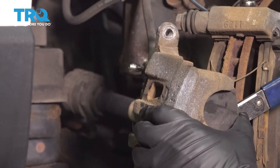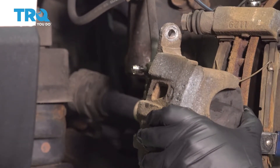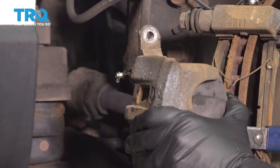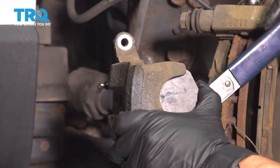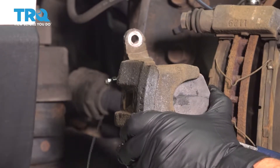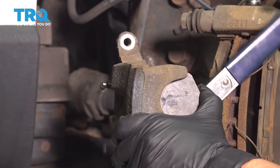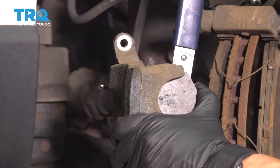The odds are it might not happen, but if it does, we're not talking about $200 — we're talking about thousands of dollars. I personally don't want to spend thousands of dollars fixing a customer's car when I could have done it right. Just better safe than sorry. Now we're just pushing that fluid out of that caliper, making sure both pistons go back. I have a catch basin catching all this brake fluid.